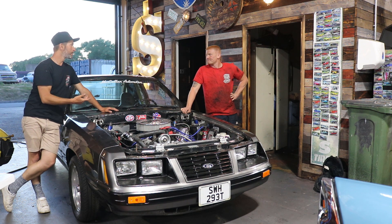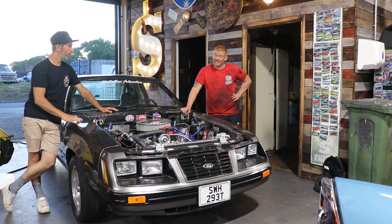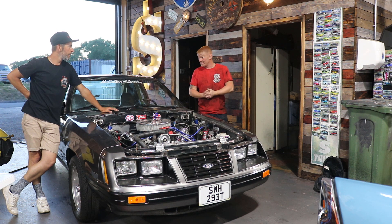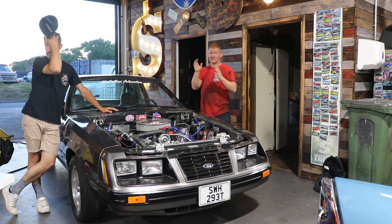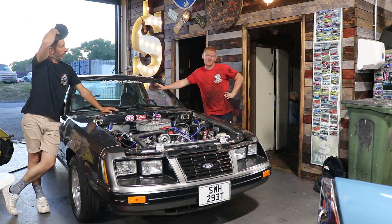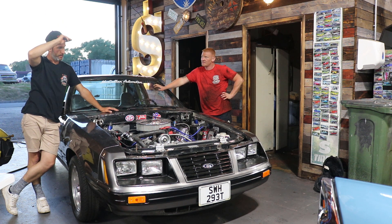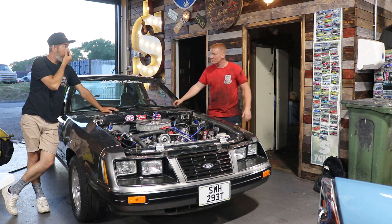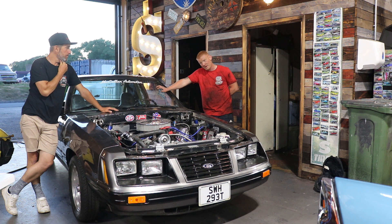Michael's better at explaining the technical side. Like we said about the bellhousings — we've had to put the bigger bellhousing back in because it clears Dale's flex plate. It's slightly deeper, so it pushes the gearbox back in the car, which in turn makes the old prop shaft too long. So we're going to have to get that shortened. We also need to check the torque converter spacing now as well, because obviously that could be not engaging the pump as much. So we've got a bit of figuring out and measuring to do, but the box is bolted back in.